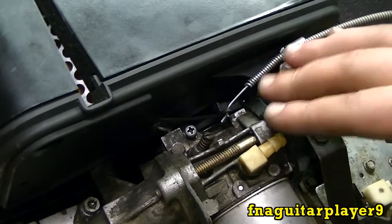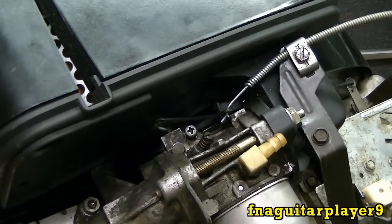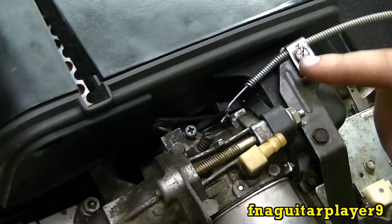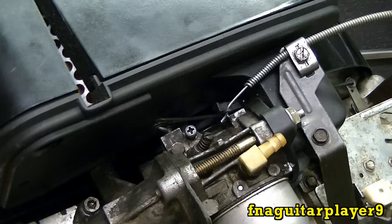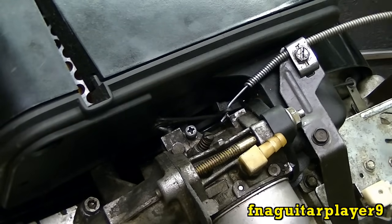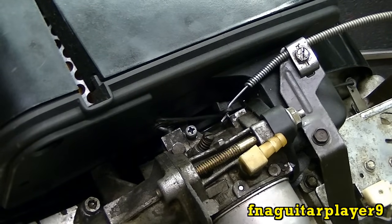Now this is basically the same with any engine, but I'll show you another engine with a slightly different carburetor just to show you another way that you can put these on. About all your newer engines are going to have this setup or something similar. Most of your new engines have an automatic choke, but I still prefer the manual choke because I don't like for an engine to rev up at full throttle when it's cold — all your oil isn't circulated yet and you can score a bearing or scratch a cylinder real easy.